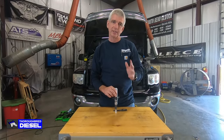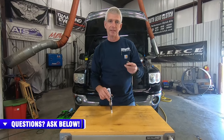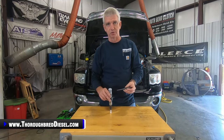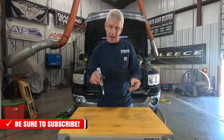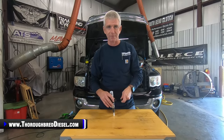Hi, I'm Wade from Thoroughbred Diesel, and today we wanted to do a short installation video on common rail 5.9 Cummins injector installation. This is a call that we get a ton at Thoroughbred Diesel, and it's because of the feed tubes. In the light duty space that Thoroughbred services — the 5.9s in the VP44 trucks, the 5.9 common rails from '03 to '07, and the 6.7 Cummins from model year 2007.5 to current — all have a feed tube. The feed tube alignment on these injectors is critical. We wanted to do a short, condensed version of how to install these injectors and get these feed tubes aligned and torqued correctly, so you're not going to have hard starts or lose rail pressure after 300 or 400 miles.